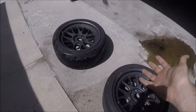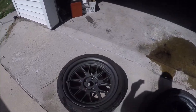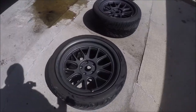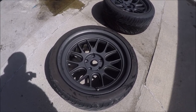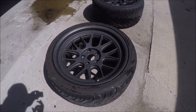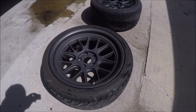This should be straightforward: wash your wheels and make sure they're clean. You want a clean surface for the paint to apply to. I'm not going to go over how to wash wheels because that's pretty simple — just make sure they're clean, no brake dust, etc. When you go to paint, make sure it's a nice day, about above 60 degrees. It's about 70 degrees right now, perfect day — sun's out, low wind. You want to make sure precipitation is low; if there's moisture in the air the paint won't apply as well and it could run.